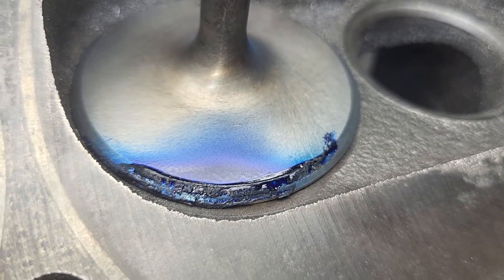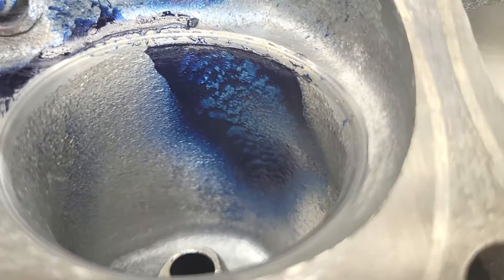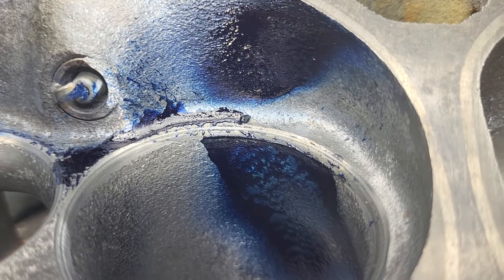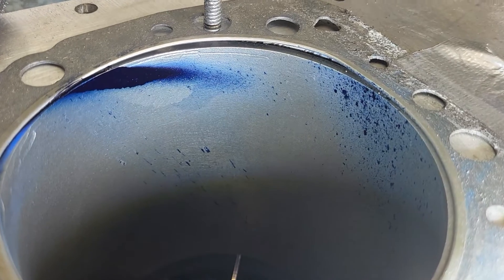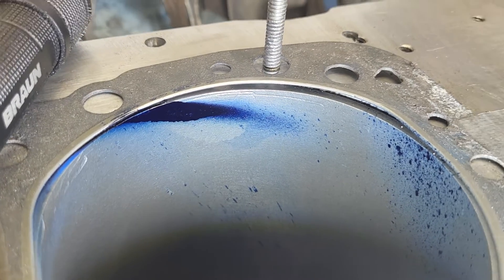Our spread on the valve is not as wide. Our spot in the bowl looks a little narrower, but still got a nice angle going across. Let's take a look at the bore before I forget. I think it is possible I swear there's less taper than what I've usually been doing, but I like the angle on that.